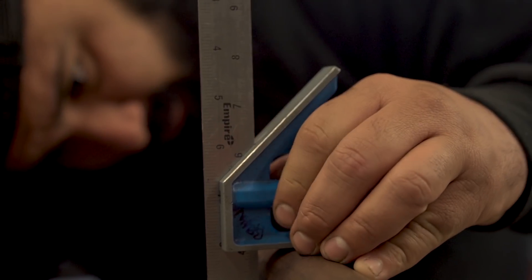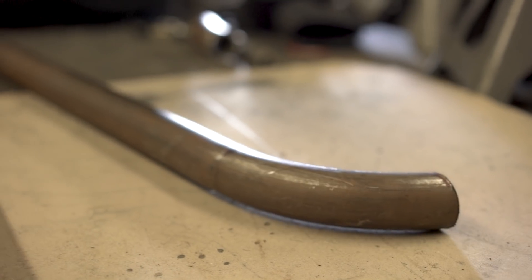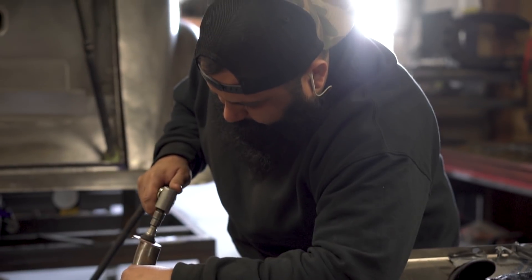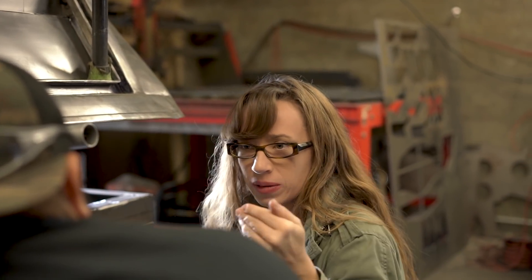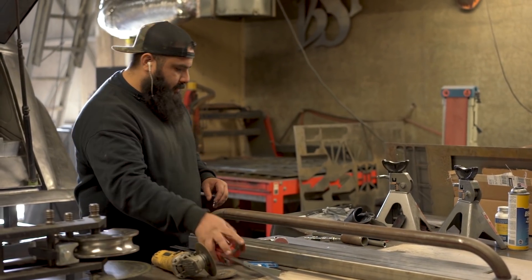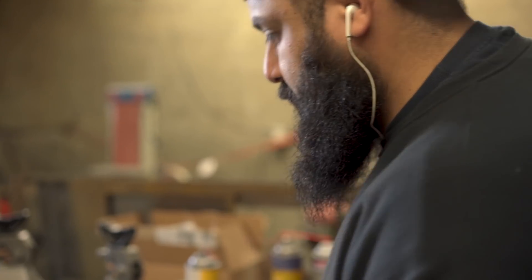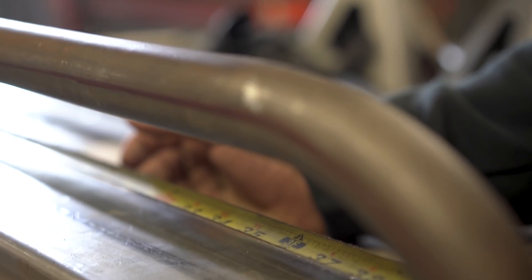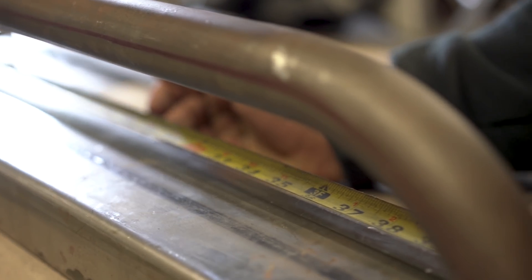But how are you able to reach it if it's round? Because it's round, it's coming across here. So basically you're saying that square would end up plugging much closer to this - it's going to almost be touching the box. But isn't that up to you with the design? You could basically have the round tubing just be plugging it and if you just made it like a sharper curve, isn't that just up to you how much you curve it? No, because with the round there's room for me to actually get a socket in here and take the box out. But with the square tubing... is that because with round you can't do like a hard 90-degree angle, you have to do like a big radius? Yeah, like a big radius, you know what I mean? Yeah, I do.